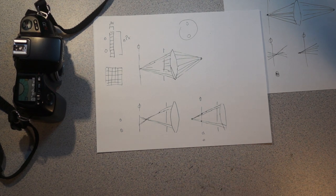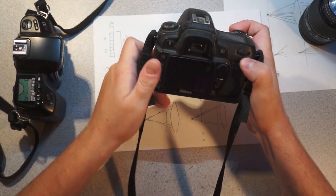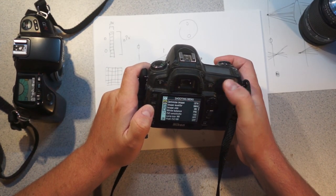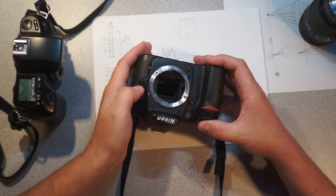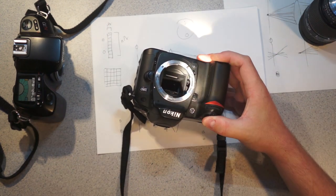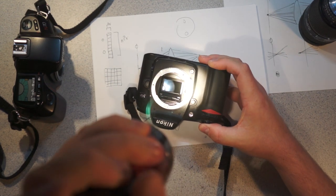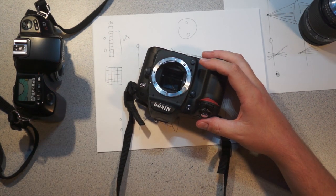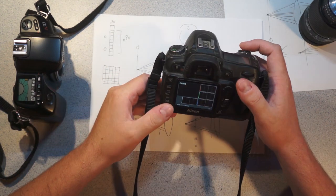But in any event, I took this apart completely. You can see that that dark color in there is the infrared filter. Normally you'd see the sensor, but because this has an IR-only pass filter on there, it just looks dark, because it absorbs any visible light and only passes infrared.